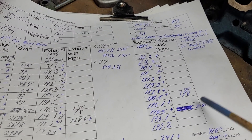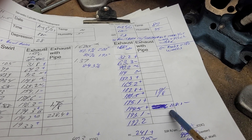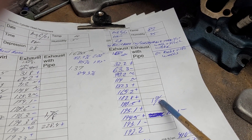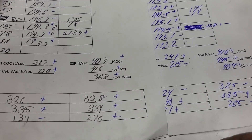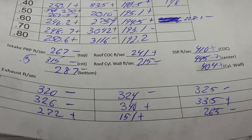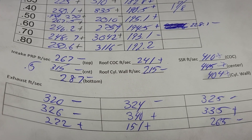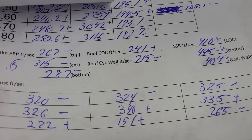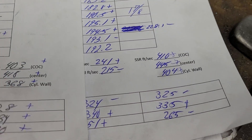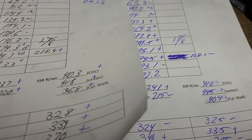I'm going to say it's definitely not a complete win. Now this one was polished, this is burred — that does make a difference. I may polish it and call it a day, because I think he's got inch-and-seven-eighths headers that get bigger. In any case, take a look at what happened with our air speeds — this is where we were with air speeds and they were quite good. This is where we are: minus, minus, plus, minus, plus, plus, plus, minus, plus, minus — relatively even across the board. We've got a little more speed in the middle; even our dead middle of the bottom came up a touch. Really not bad — in fact it's quite good. So making it bigger doesn't make a big difference.